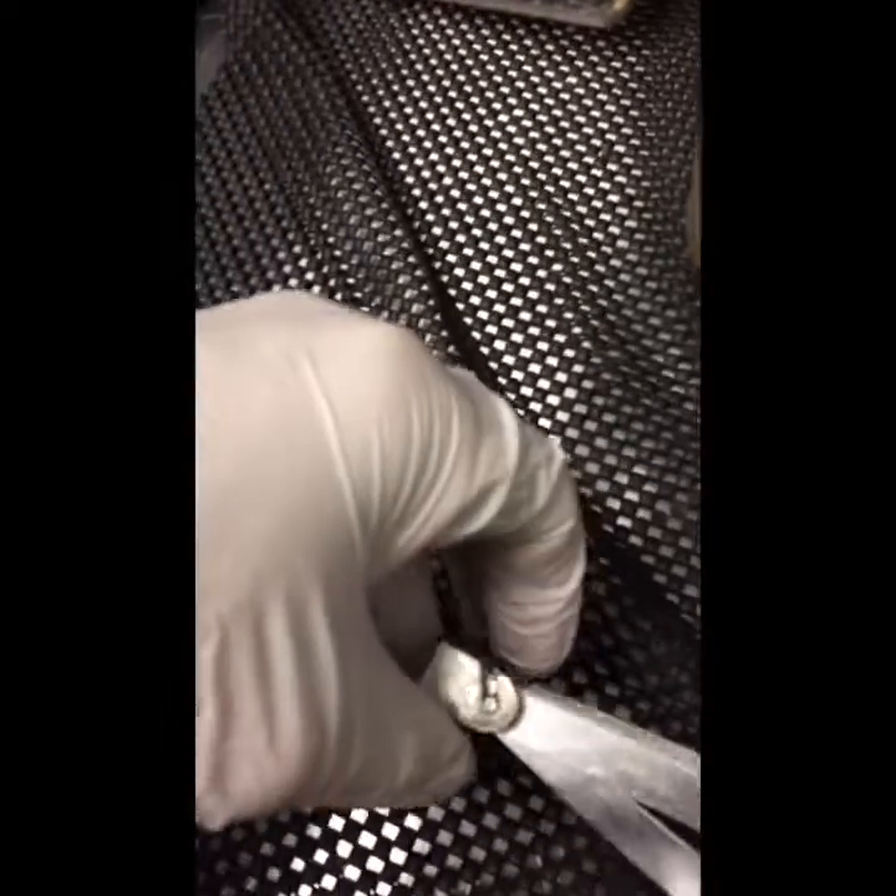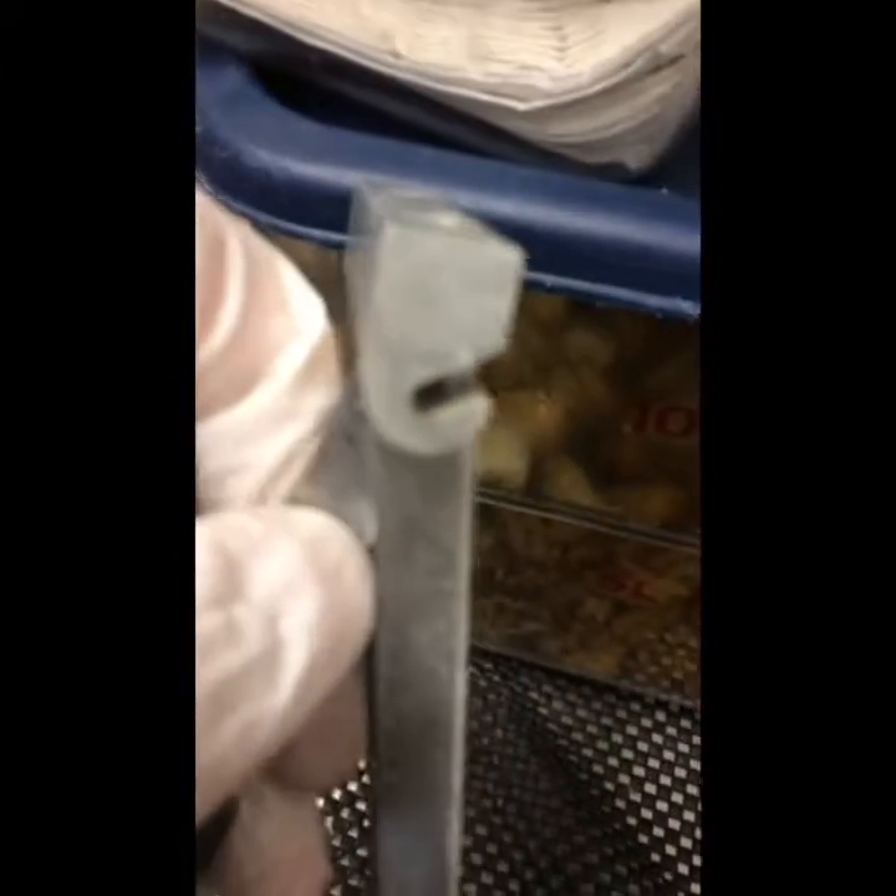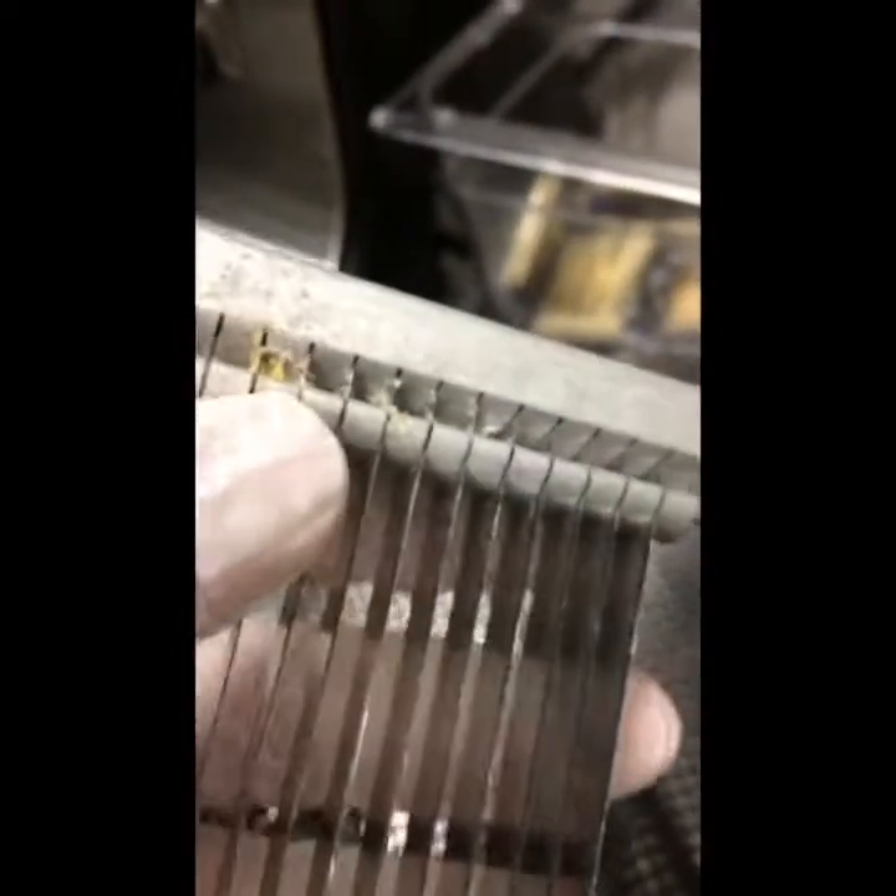I already got one side of the blade out. There's two pins up top - all you've got to do is push that down and in, which I'm going to do now using the needle-nose pliers. Push that pin in - it's kind of hard there. Pull it out, just past the blade. Push it up on it and it comes right out. It works.